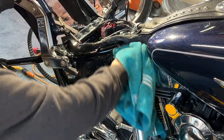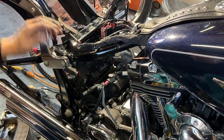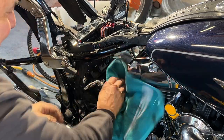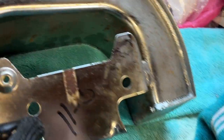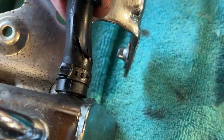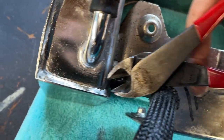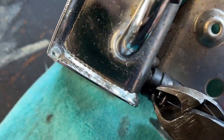When you do stuff like this, take the opportunity to wipe stuff off and clean things you normally can't get to — like this transmission cover right here. This bracket right here just holds the coil and it goes right back in there — we'll worry about getting that back in after we get his oil tank back in. I'll show you guys where the tear is. Can you see that? That's where his oil was leaking — and that's why they wanted to charge him like a thousand dollars to replace it.